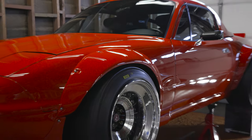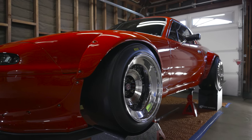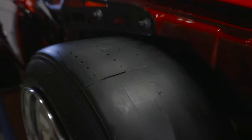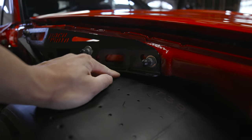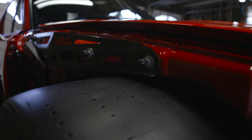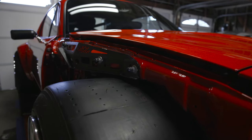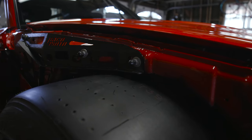No matter what you do you're going to have wheel gap, because if you rock this kit without wheel gap I'll show you — I took off the fenders on this side. Look at this: this tire I'm using is a 23.5 inch OD and it's barely clearing the setup right now. This is about half an inch, so half an inch is not a lot. This isn't my final setup right now because I think it's a little low — my suspension setup is stiff so I don't think I'll have a problem, but I want a little more clearance for more suspension travel.